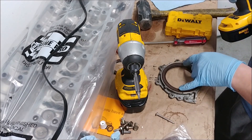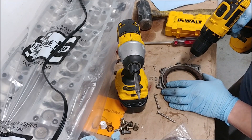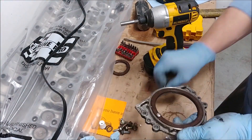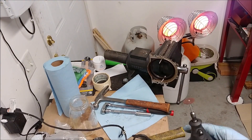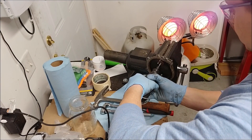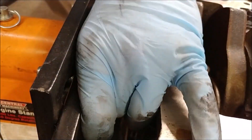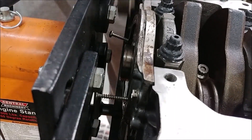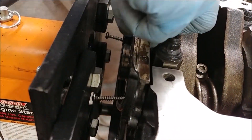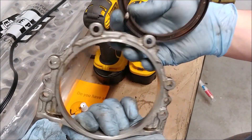Let's try something here. I'm going to try to throw pilot holes, put these through, chop off the end once it's in the seal, hand tighten that stuff on there, and try to pull the seal off with these screws to see if that works. I was successful in my attempts to pull it out with this makeshift little presser that I set up. Clean this guy up and install the new seal.